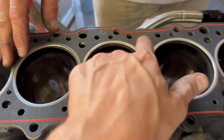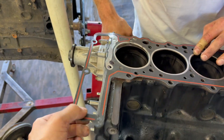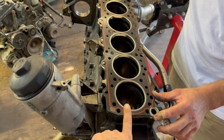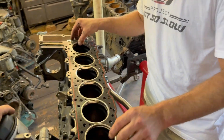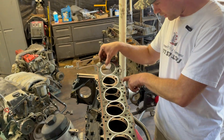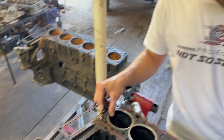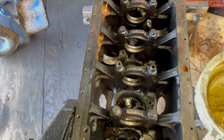Let's put a 603 gasket on a 606. You can see here, everything lines up perfectly. You could use the worse head gasket in a real pickle — the only problem is the head won't drain right here, and the oil drain is also missing. Looking at them upside down, the blocks look very, very similar underneath.